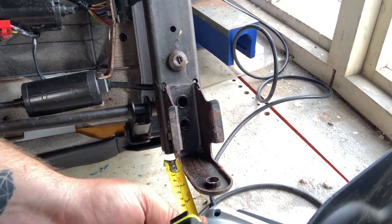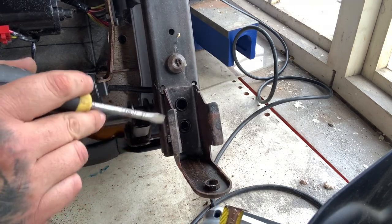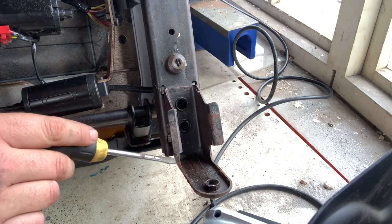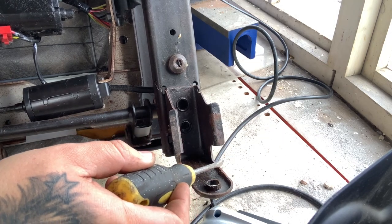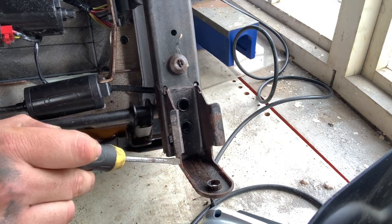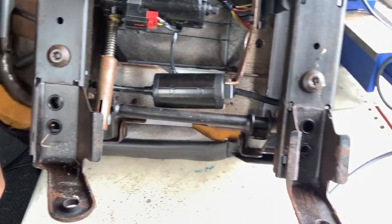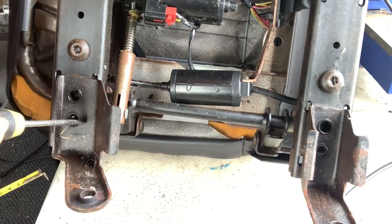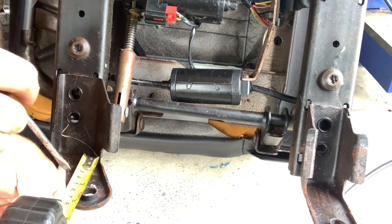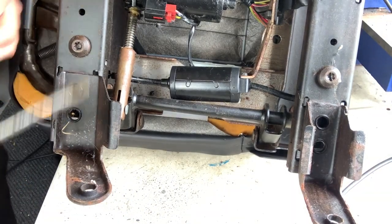I'm just measuring this distance here pretty crudely. I'm going to cut these - where they rest on the floor of the car - I'm going to cut those off because obviously we need those to be shorter to get the seat to sit lower. I'm measuring from this piece here down 35mm, because I'm going to cut flush with this line back, cut 35mm out of this, weld it back on. Same with this side - it's at an angle so slightly more difficult, but we're going to be cutting a straight line parallel. Crudely marking it up: 35mm from there, 35mm from there, 35mm off both of the rear ones.